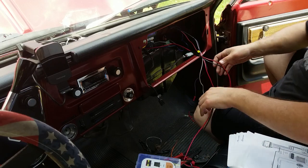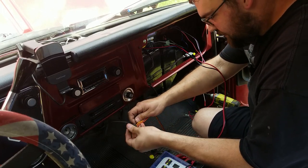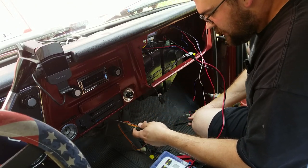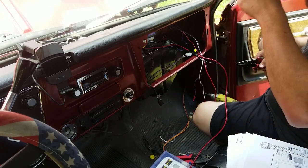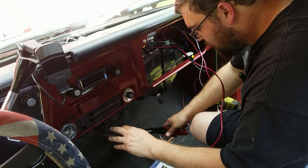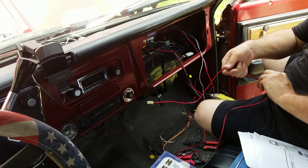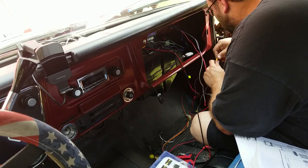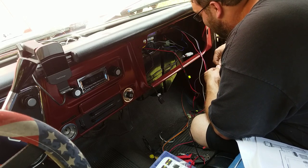Looks like it's actually teed off. So we're going to use the existing power that was feeding the fan control. The reason for that being is that it already has a 20 amp fuse and it's already switched. And so that will make a good solid 20 amp input connection using the totally good, clean, solid old wiring in the truck. Nope, don't strip that yet. I'll put a connector on it. So this can be considerably shorter. And then our ground that's running out to the battery post or whatever. Yeah. I'll find a ground in here for that. Surely the cab is a solid ground.